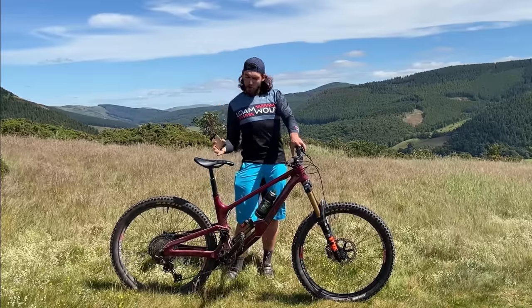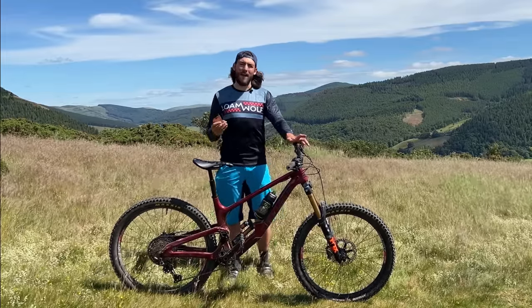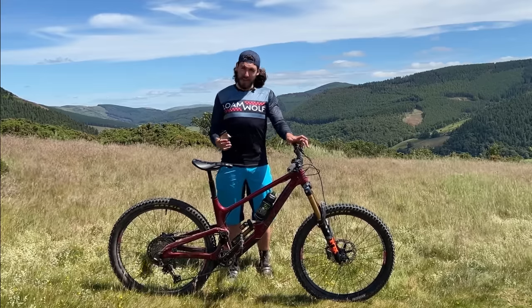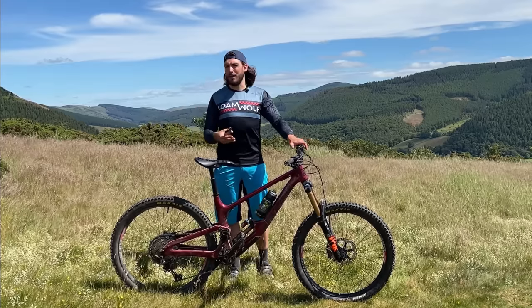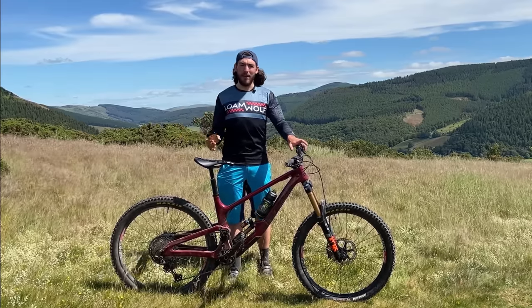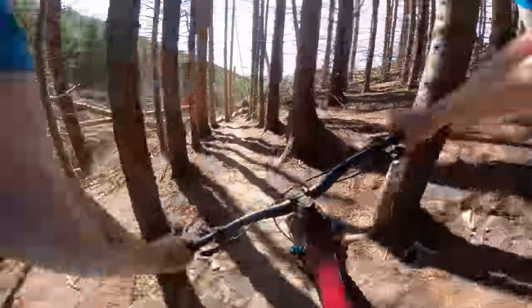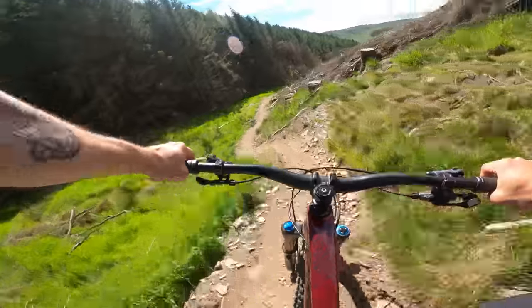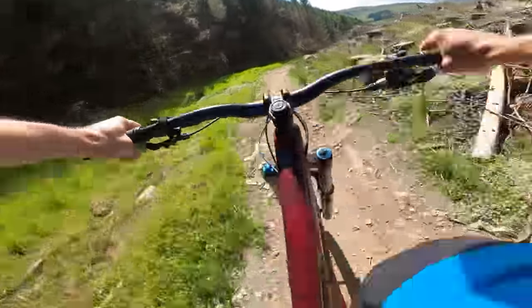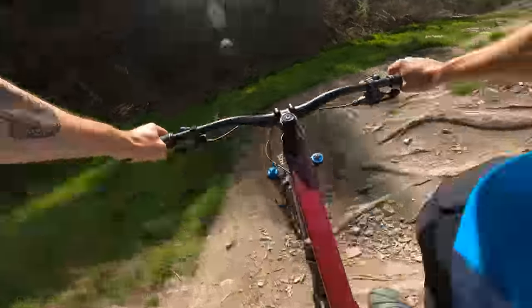This movement of the rear wheel away from the bottom bracket also produces a lot of anti-rise or brake squat, which can be considered a negative or a positive. In Deviate's case, they're saying that it allows the bike to maintain its geometry when you're hard on the brakes, which, especially in steep terrain, should lead to a slightly more confident response. But it also means that the suspension does feel to firm up when you're in its travel on the brakes, which might not suit everybody, but we'll talk about that a little bit more later on in the ride impressions.